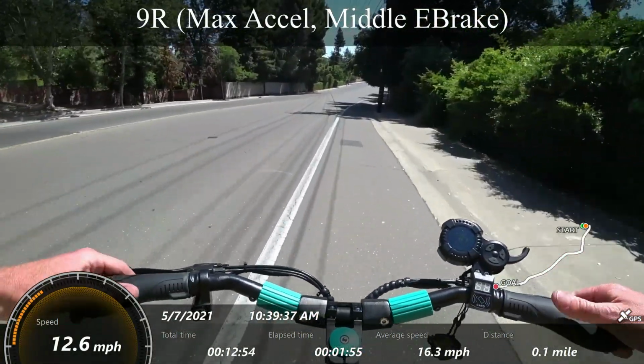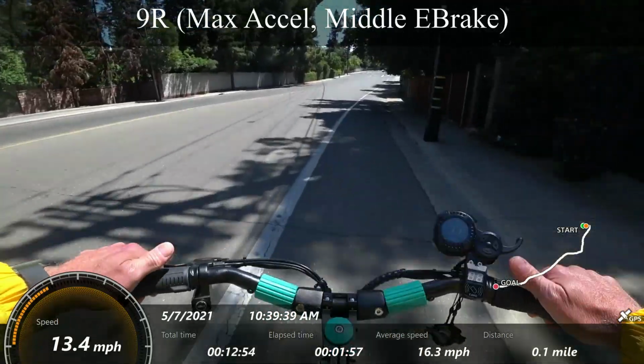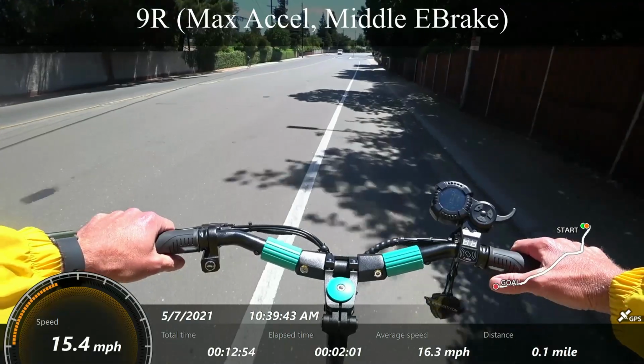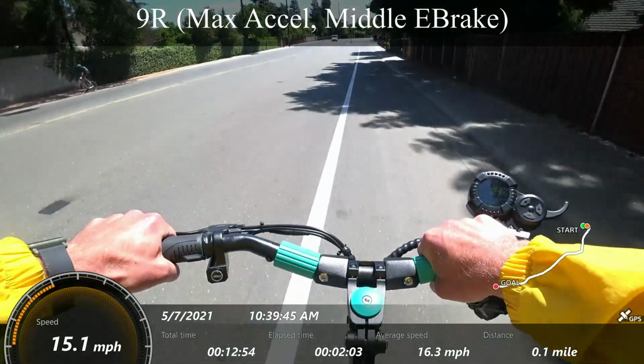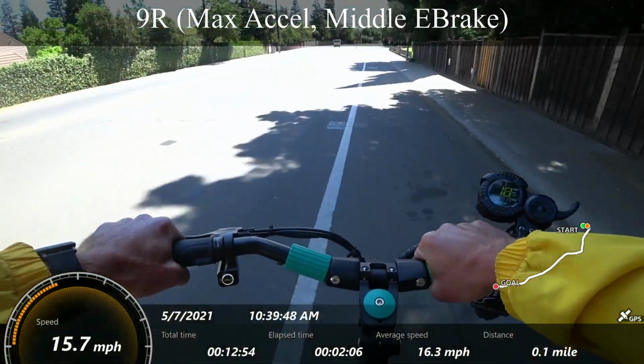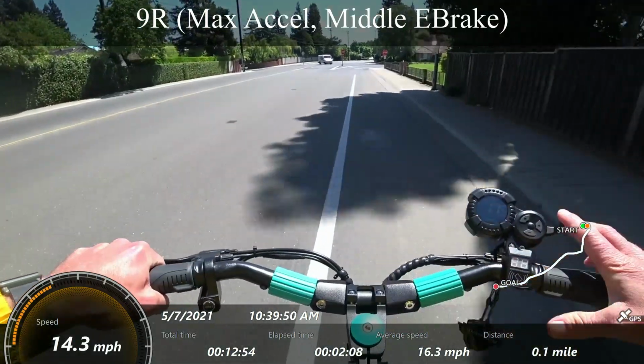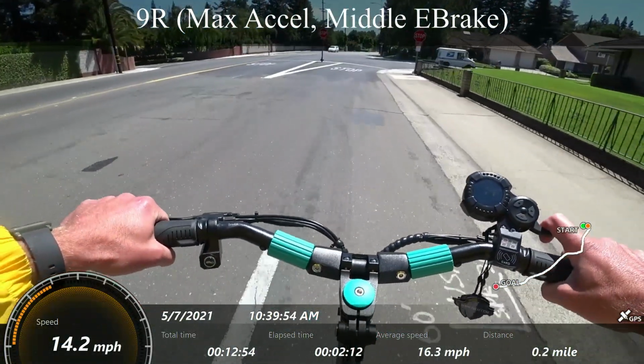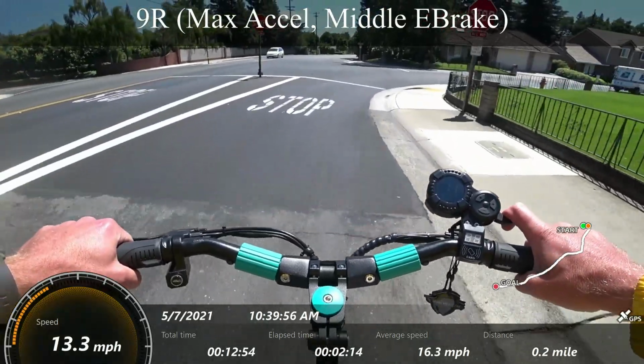Quite stable, nice flat section of the grips from ergonomic. This little bump is your turn signal actuator. These collars here do tighten in. They're threaded collars. They do tend to come a little loose as you're riding, so you do have to kind of retighten those on a longer ride.